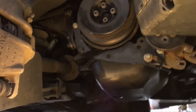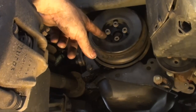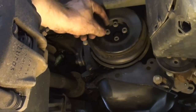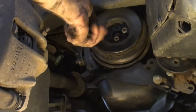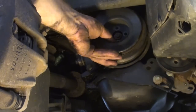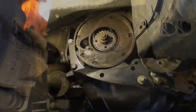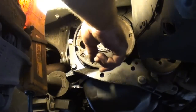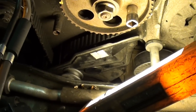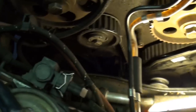Next we're back on the right side of the vehicle. As you can see, there are Allen head bolts — they're actually called cap screws — that go around the perimeter of the balancer or damper. You want to take and remove them; they're 6mm Allen head. Once you get that off, you might have to take a dead blow and wiggle it a little bit, but just take that off. Next you want to remove any retaining screws or bolts that hold the bottom plastic timing cover on — there's one up top, another bolt there, one slightly under that tensioner, and one more. Then remove that cover.